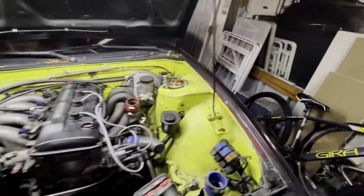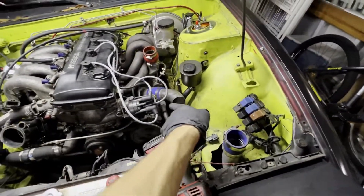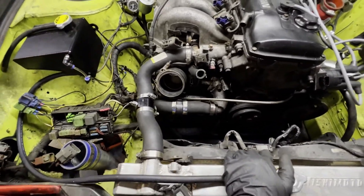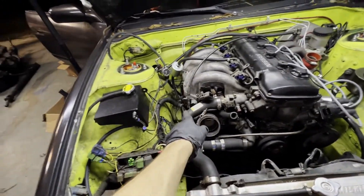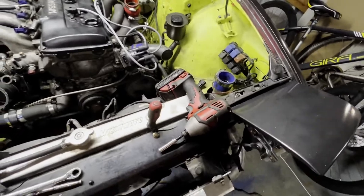It was so hacked and junky I couldn't stand seeing it, so I ripped it out and threw it on the floor. I also took out the charge pipe and the MAF. That other plug is for the high pressure power steering connector that adjusts idle at low RPM when turning. I still need to do the starter wires and alternator wires, vacuum to the booster.